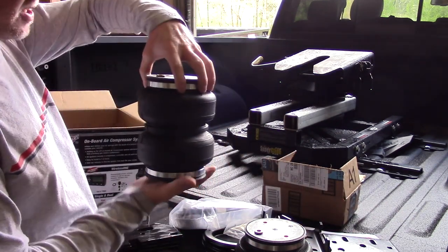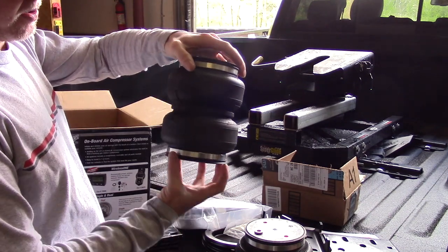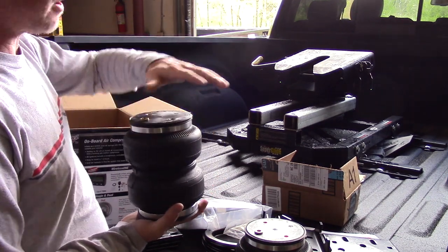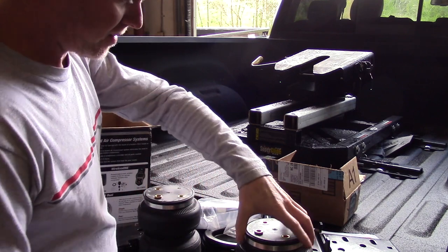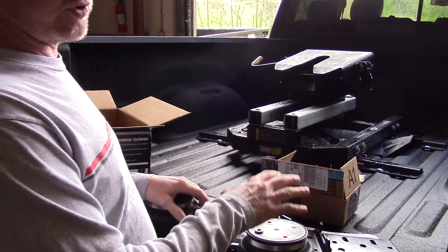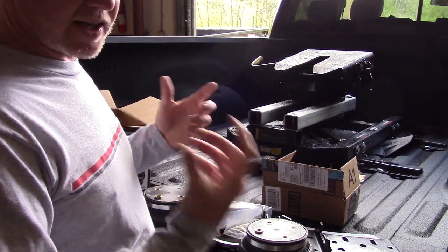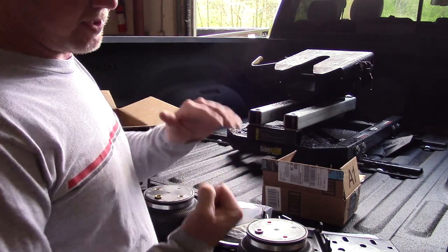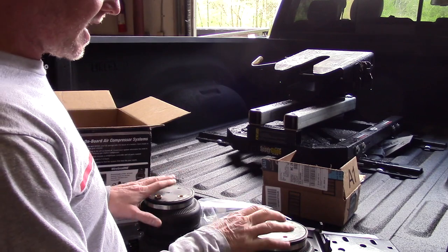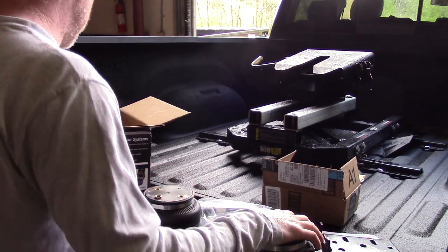Basically, you bolt this plate assembly, where you'll have a plate here and a plate here. The part that goes on the axle will be on the bottom. The part on the top is a plate that bolts to another plate, and that goes to where your little jounce bumper rubber isolator is. Before you put these on, if you're riding down the road and hit something really hard and the axle comes up, it's not hitting the frame or completely bottoming out, it basically hits that rubber absorber. These have those internally, so we're going to remove the stock ones and start getting everything mounted.